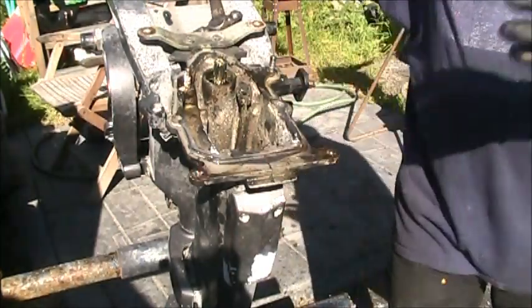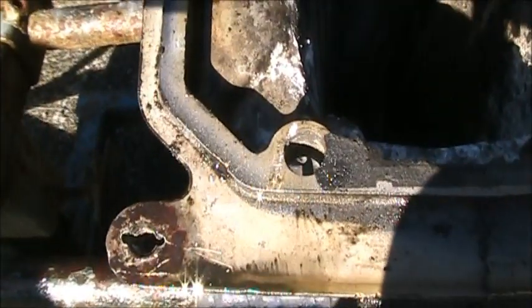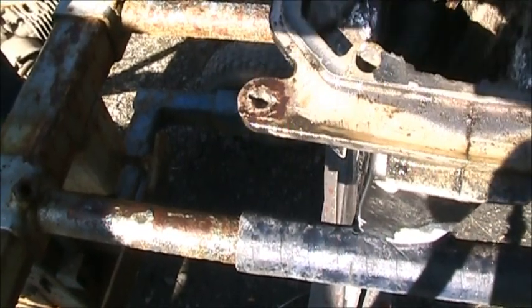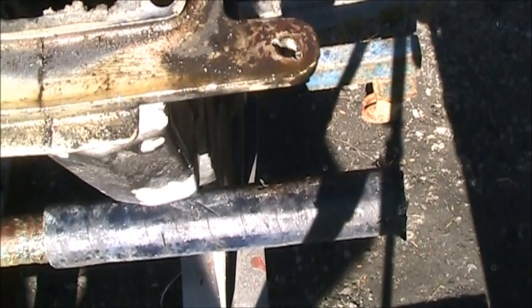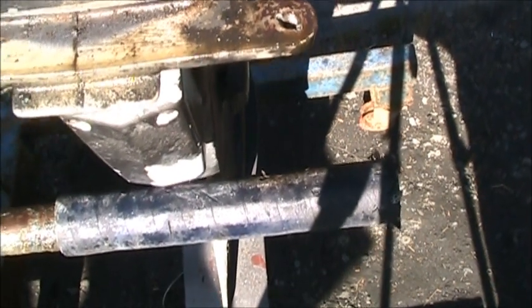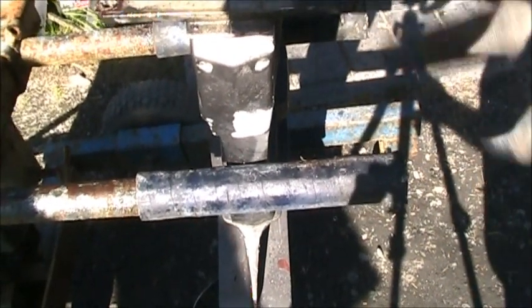So when I put the new pan on, you can see my little holes go right down alongside the bolt. And that's what you want to do, is cut a channel on each side of the bolt threads. Put the lube in there, get the heat. And a good set of needle nose vise grips is what I like, and get to rocking and rocking and rolling, and they come out. And you can do that all over aluminum.